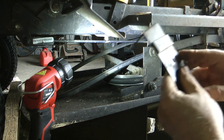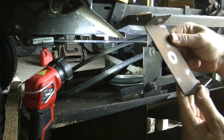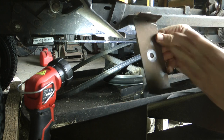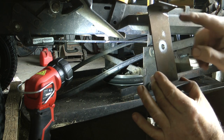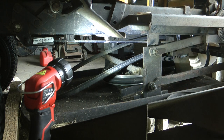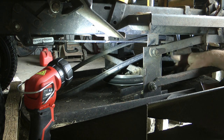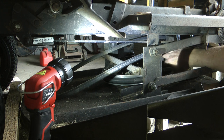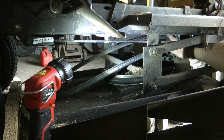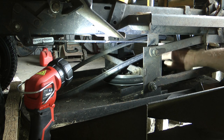And this will go back there with the lip at the top, which will stop it from doing this business. Obviously, you can see by the shape of that, it's elevated up at this end for it to go in and out with a bit more ease. It won't scrape. So remember, this is the tension, and this is the engaging pulley over here. And it's got the same guide on it. Again, you're going to have to undo this one to get this belt off completely.